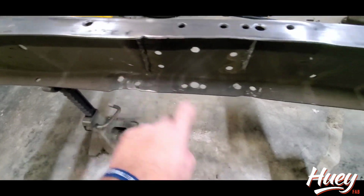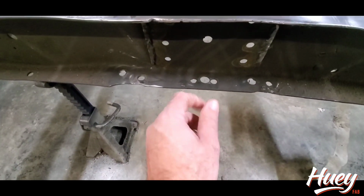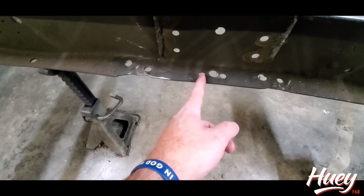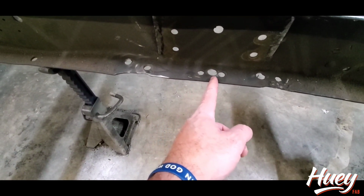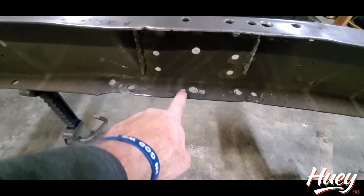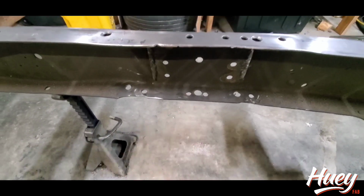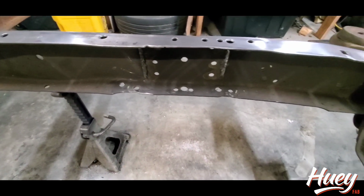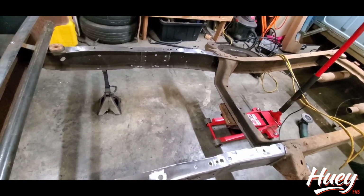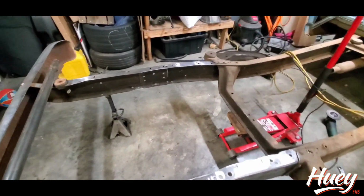So I got my front bolts, my rear bolts, and my centering pin drilled. Now, one thing to talk about is some people go off the front hole, some people go off the back hole. A lot of people go 3/4 off of center of the front hole, and that's how I do them most of the time. I've had people request to go off the front hole. If you go off the front hole, you probably have a better chance of running a Mustang 5-speed transmission out of either a Fox or an SN95 or a New Edge, and the shifter not getting to the bench seat.